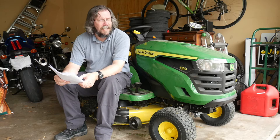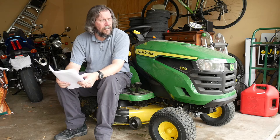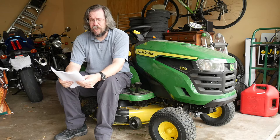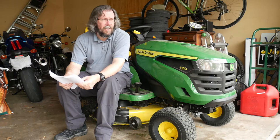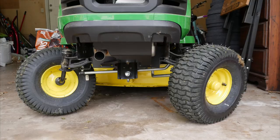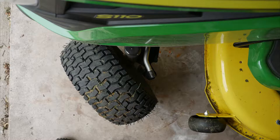I've got 3.7 hours on this so far — I've mowed about five times, taking roughly 45 minutes per mow. I can get about three mowings out of a tank of fuel from the 2.5-gallon tank, which is standard across most of the 100 series. A couple people have asked about oil: it just uses 10W-30, and you change it every 50 hours or once a year.